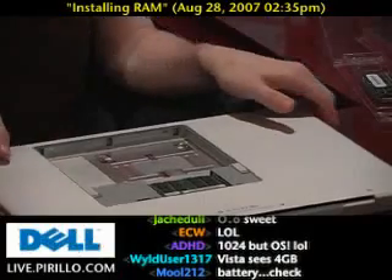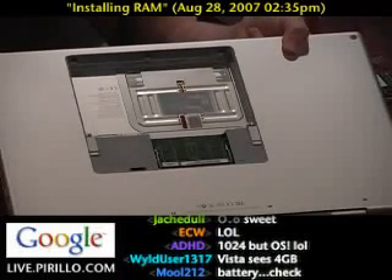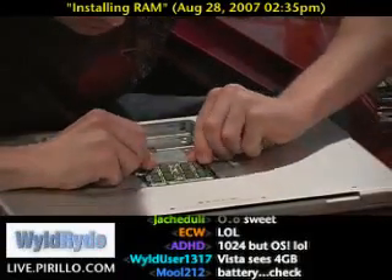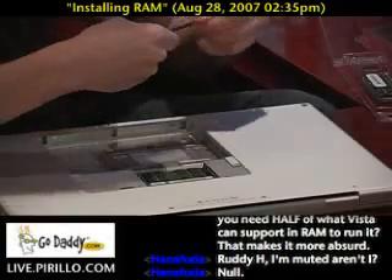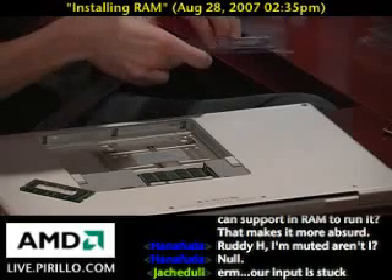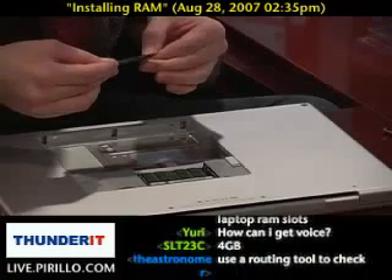What I've exposed here is the place where the memory is currently seated. Apparently someone's trying to call me — they're going to have to wait. I'm in the middle of something very important: upgrading my RAM. I'm going to take the first SODIMM out. There are a couple of metal clips that I push to the side and this one pops out. This is a 1 gigabyte stick, Samsung manufactured. I'll be replacing each one with a 2 gigabyte SODIMM 667. Same number of pins — 200 — DDR2. We should be good.